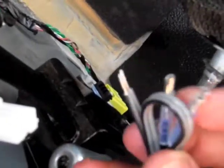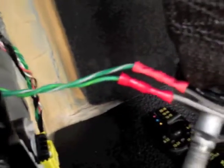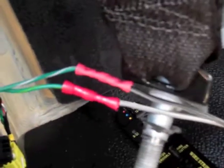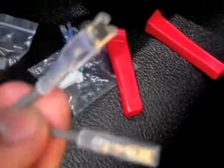After that, these two connectors are going to hook up to those two little things, and then it should be able to play. Here's how it should look: I cut those two green wires, added the two clips, spliced them in, connected the other two sets of wires that Kicker sent with the speakers. Those are going to go straight into those connectors.